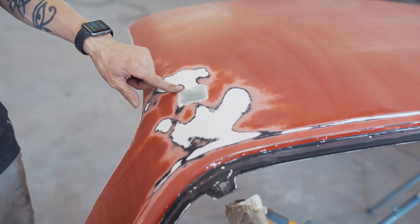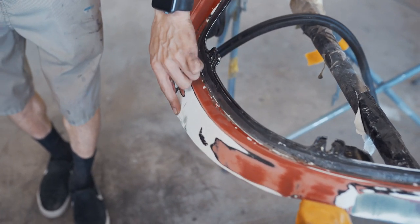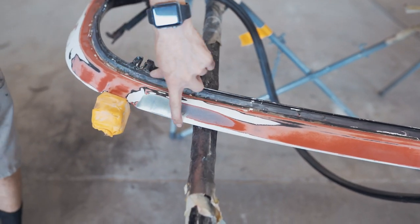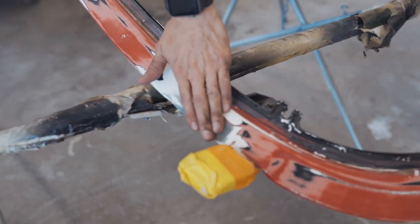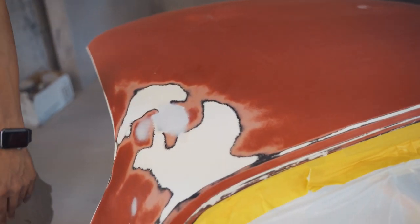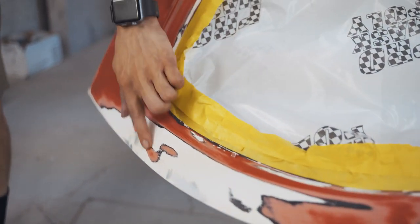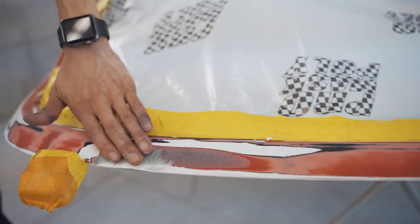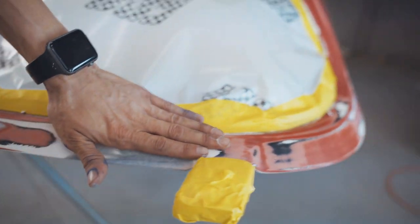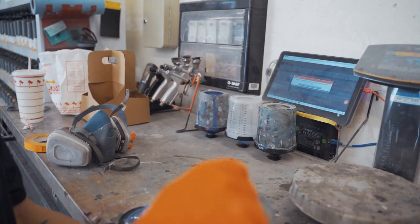You can see the fiberglass repair is done here — the repaired spots are feathered out so they're perfectly smooth. The crack is filled in, and the missing edge is all fixed. The top is ready for primer. We've finished the whole thing in 180 grit, fixed all the damaged areas with fiberglass, and finished with a flexible body filler — you can see all the little white spots are flexible filler. The bare fiberglass is nice and smooth. We're about to spray primer using a spray gun and air compressor. Without a spray gun, you can use spray cans, but it'll take a lot more paint to get the same film build.